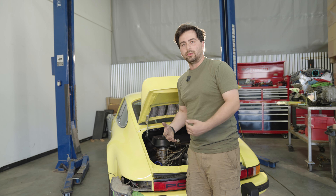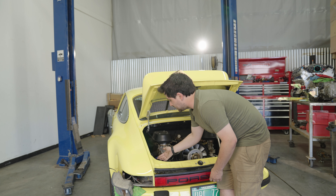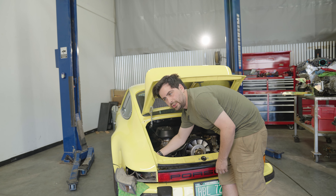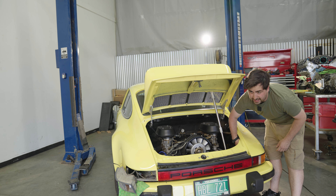I'm going to go ahead and unplug the electrical body connector. There's going to be one located right here under the deck lid. It's kind of hard to see, but if you reach in there you can feel it — you're going to pull and unplug it, and there's one on this side too. Go ahead and unplug that one as well.